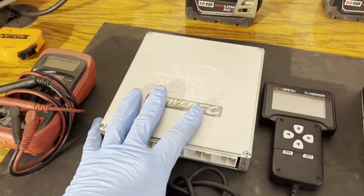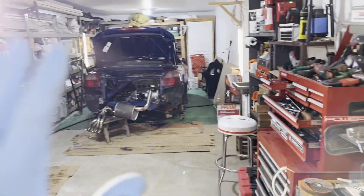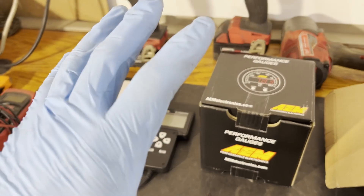The DataLogIt is what I have coming to be able to tune the ECU from my computer, but also to log the air-to-fuel ratio with the serial output from the gauge itself. I'd like to get the wideband in the car while the car is still NA, maybe drive it around a little bit NA just to get a feel for it and see where the stock ECU wants the air-to-fuel ratios to be. Then I'll hook up the Apexi Power FC, which is currently tuned just for a stock NA 2ZZ but adjusted a little to smooth out the mid-range, and do the same thing to get acquainted with the air-to-fuel ratios the car is running.